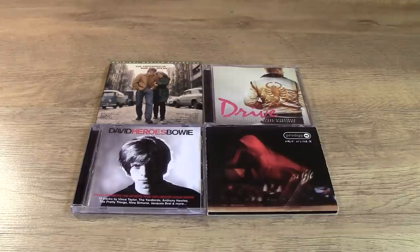So the big question is, of course, why clean CDs? And the answer is simple: it improves the sound quality. Why does it improve the sound quality? If the disc is clean, it is easier for the laser to read the disc accurately, you have fewer errors in the data stream, and the sound quality is better. If the disc is very dirty, it's possible to have data errors which are covered up by error correction, and it's possible to have timing errors known as jitter. The cleaner the CD is, the better the sound quality will be.